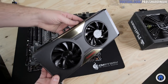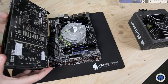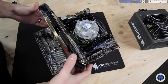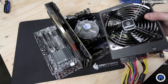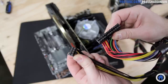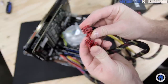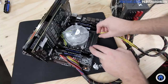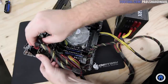The video card will be next. It has a long PCI Express connector at the bottom, which also has a notch close to the bracket. This goes into the black PCI Express slot that is closest to the CPU, and the graphics card should drop into place without too much pressure. Try not to bump it, though, because there's no bracket to hold it in place at the moment. Now we're ready to connect the power and a monitor. We'll need the 24-pin main motherboard connector, the 8-pin supplemental CPU power connector, and the two 8-pin PCI Express power connectors for the GTX 770. Remember that there's a latch on one side of each plug that will connect with a catch on the motherboard connector, and don't mix up those 8 pins — the ones for the graphics cards are 6 plus 2, so line those up first.